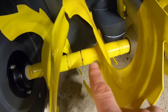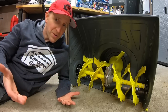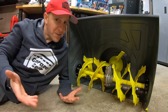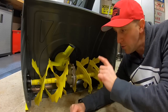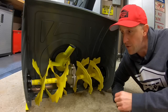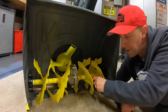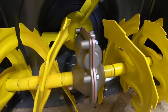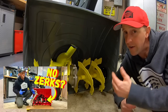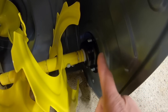Let's start up here in the front. Shear pins. These could break just like they do on any other gas model. And you should check them throughout the season a couple of times to make sure that they haven't snapped. And if they have, you may see that one or a couple of your augers aren't spinning. Your augers. You should make sure that they're lubricated at least once a season to prevent them from seizing to the auger shaft. If they were to seize and you hit something hard, like a rock or a fallen tree branch that was buried underneath the snow, your shear pin wouldn't be able to break, possibly causing damage to your gearbox. I did a video recently on how to lubricate these types of augers without grease fittings, and I'll have that video linked down below in the description. These bushings here on the end could use some lubrication at least once a season as well.